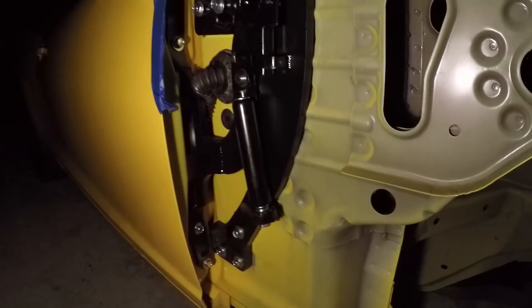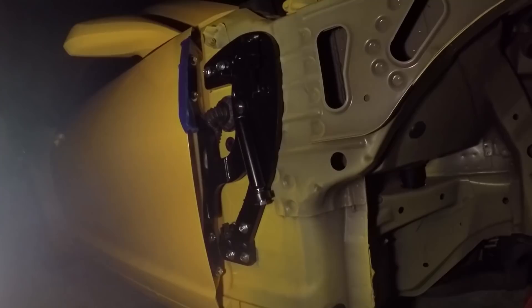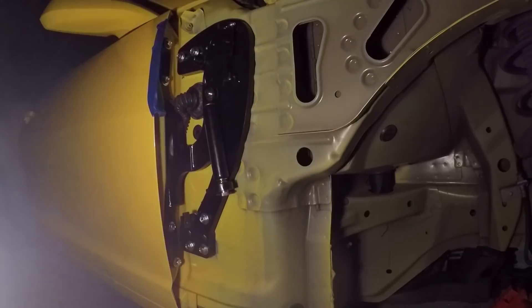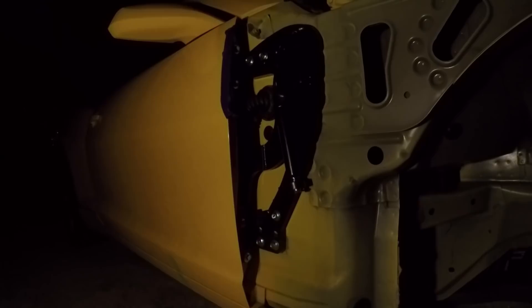Here is the actual door hinge. The shock right here is what makes the door really easy to go up and down, and everything else is just hinges for the door to articulate in, out, up, and down. You can see all the alignment marks we made on the bottom — after we put the new hinges on we just had to make sure those were correct. They're very, very close — actually spot on. The gap and everything looks pretty good. The other side might need more adjustments tomorrow. I still have to go in and get the wire loom completely readjusted, because you do have to pull out extra wire for it to sit properly.